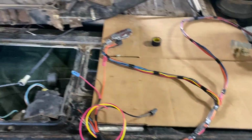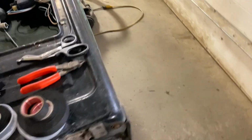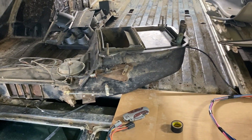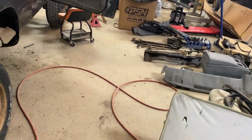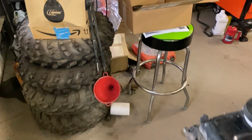And then I'm not 100% sure if I'm gonna just power the ECM on when I do the remote start, to just power the ECM on. So have the ECM on and not having the interior stuff on. But I'll probably tap into the ignition switch wiring and bring it down to the fuse block, wherever my steering column is. It's over there. I'll probably tap that down there and bring that on.